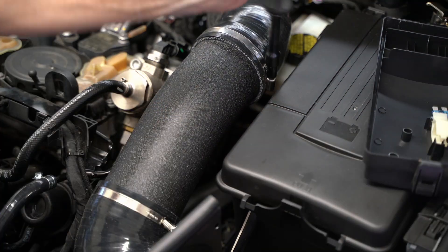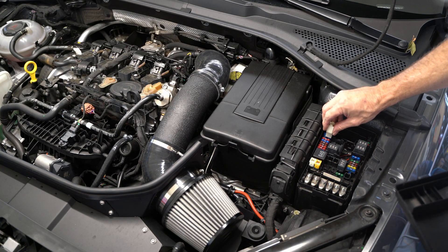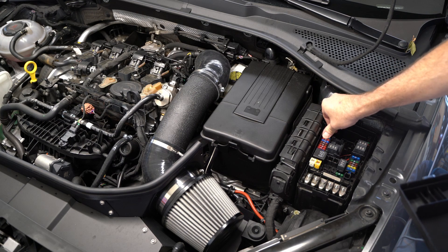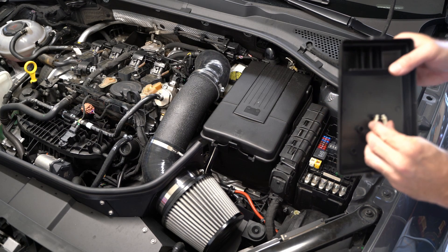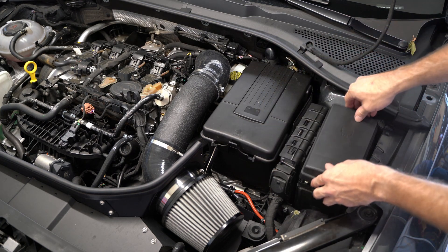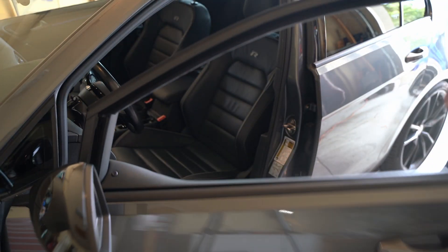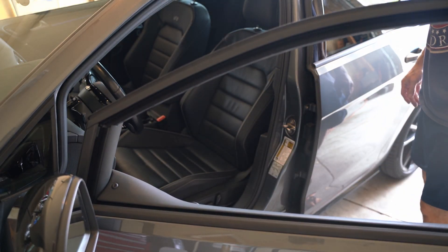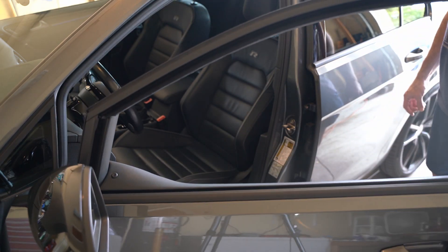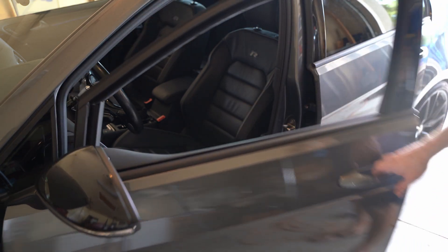The intake goes back in for me — I found it was easier to get in there to that lower fuel line fitting. I'm tightening that down and replacing my fuel pump fuse right back in its little spot. When you open the door it primes the pump, so I'm opening and closing the door a couple of times just to prime it extra well.